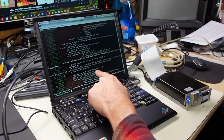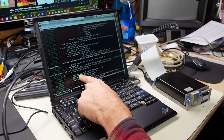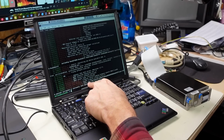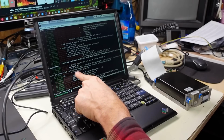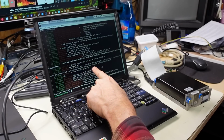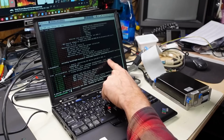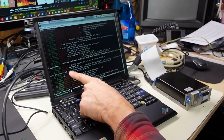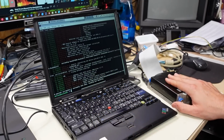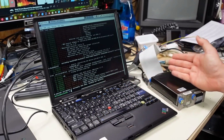It says Adaptec, there's the Adaptec driver there for the 1520X SCSI driver. But that's it. Normally it should have auto-detected the hard drive. It says resetting bus. So yeah, I don't know. IRQ 3, SCSI ID 7, so that's what we thought. Parity enabled, blah, blah, blah. This drive absolutely should be working.